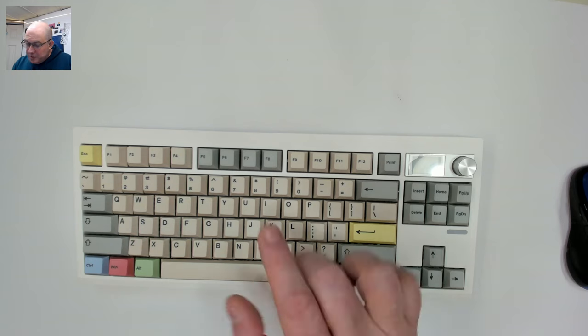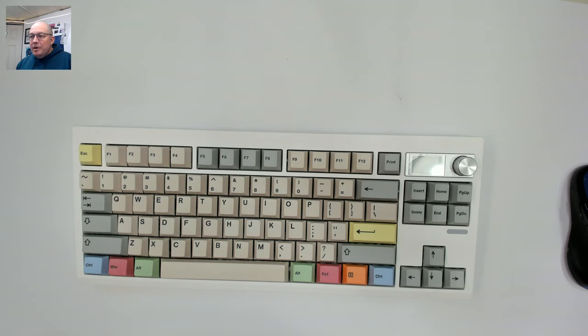Now, there's one thing, especially with these, that may not count for all of them. There are two types of Via. The Via that's original Via is a QMK keymap. That means there's a QMK source for it somewhere, most likely in the QMK firmware tree, although there's a couple of companies that keep their own GitHub or GitLab source control repositories with their QMK source, and under the keymaps folder you'll have a Via file, and that basically adds a layer of Via communication. One of the things that true Via can do is send QMK codes directly into the firmware that tell QMK to do specific things.